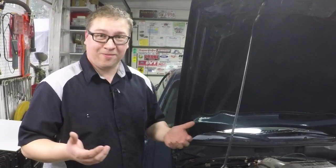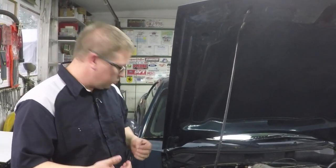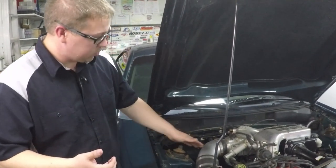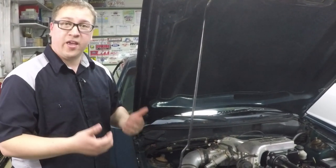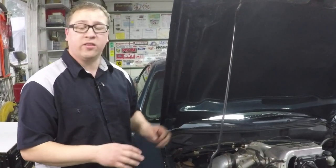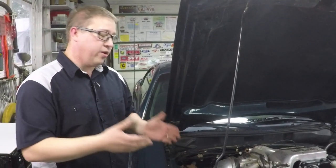So I've gathered the necessary parts — a set of pre-made Fragola lines, some fittings covered in the part list below — and I'm going to show you how to change your own system to prevent fires. The fuel lines are located on the passenger side; they start down by the firewall where the hard lines come in, then move across under your inlet system or cold air kit, sweep across the valve cover, and enter the fuel rails on the passenger side of the engine. Before we take parts off, let's take a look at the parts we're going to put in.